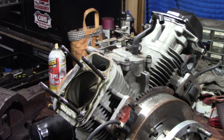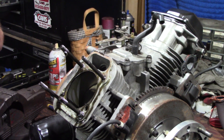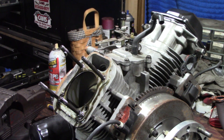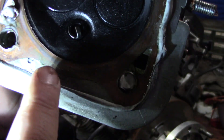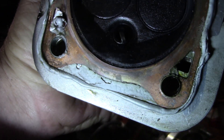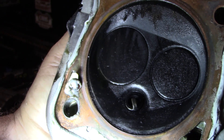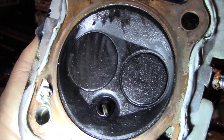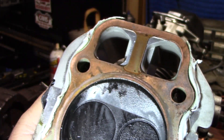Alright y'all, I don't know if you can see that right there. This head gasket was not sealing very well at all, right down along that bottom edge. Is that a copper head gasket? It's a copper head gasket, completely embedded in silicone. And it actually looks like they're used head gaskets off of a fire ring engine — you can see the fire ring impression going around it.